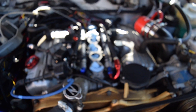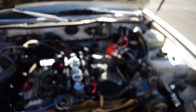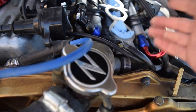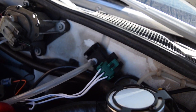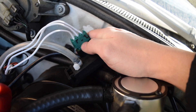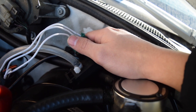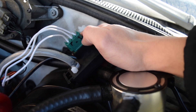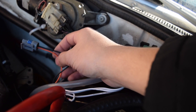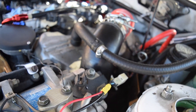For the CHTS, it has a coolant temperature wire coming out of the harness, and the other wire is a ground. That one doesn't matter the polarity — it's just a thermistor, so you can put them to either one. I used the stock wires: yellow and black, with black being ground. For the MAP sensor, it is a three-wire sensor. We have the ground on the very far right, the signal in the middle, and then a 5 volt. The 5 volt shares with the rest of them, the signal wire goes to the MAP pin, and the ground is the sensor ground. For the intake air temperature, we have a signal wire and a signal ground.